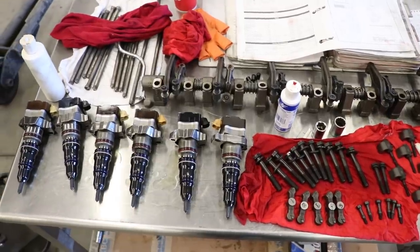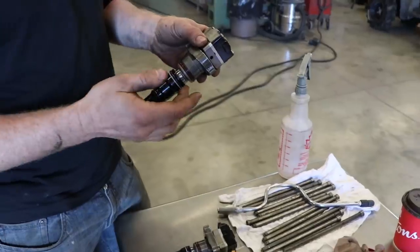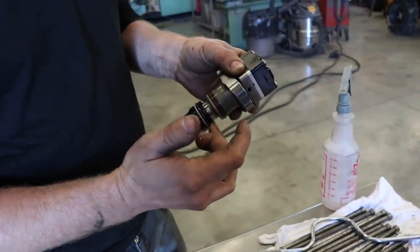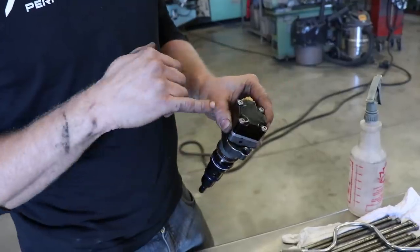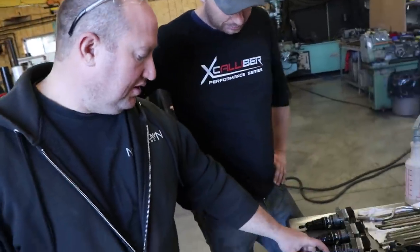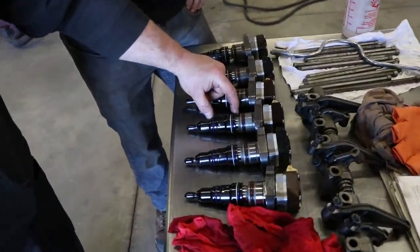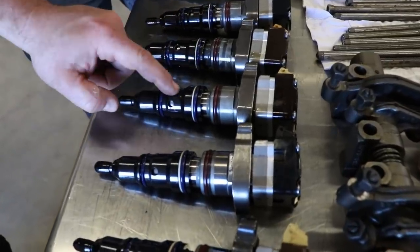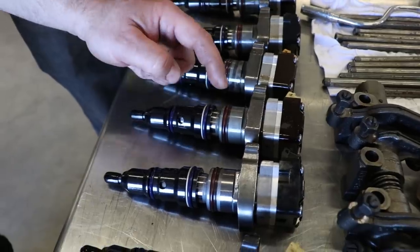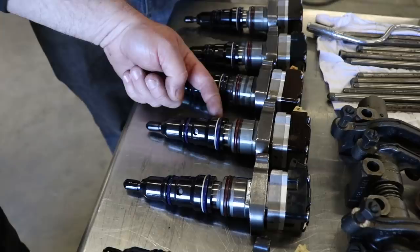Okay, so the injectors, as Scott, you've seen in the video, he replaced the cups, and that's important only because the injectors through here actually get oil pressure from the engine, and that's what actually fires the injector by a signal on the top. Most of the tubes, when we do them, there's coolant in the head too, right? Yeah. So the tube will sit right here and seals off coolant getting into the injector, and then that's the passageway for the oil. It's still in the head, but cast in the head. And that seals up between here and here.